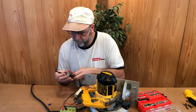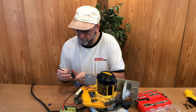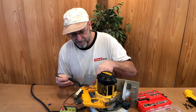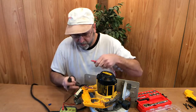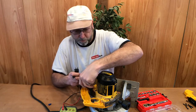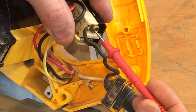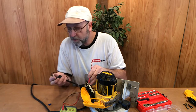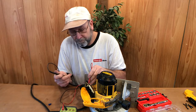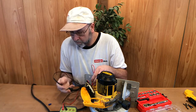And you know what? I'm not getting anything. This could be an easy fix. Nothing. All right, let's go to our hot side. And our hot side is coming up, and it's coming in right here, bottom of the switch. So let's go ahead and test that. Okay, so our hot is good. We have no neutral. Go ahead, touch on neutral.